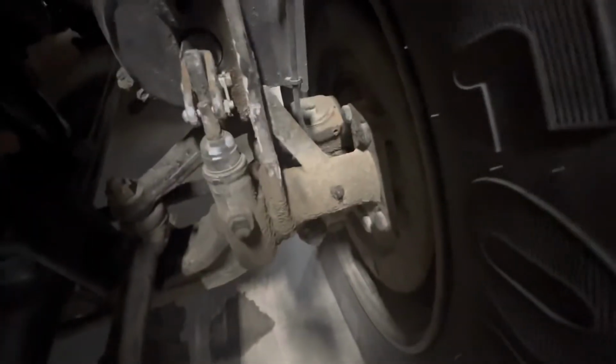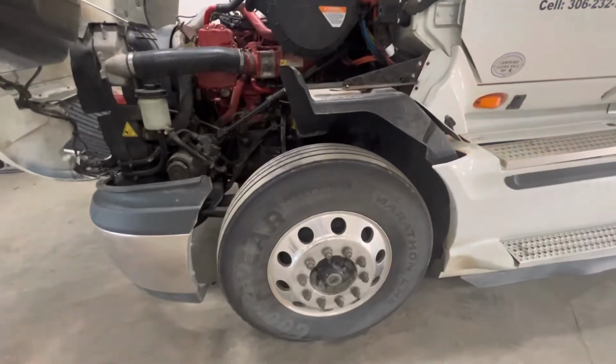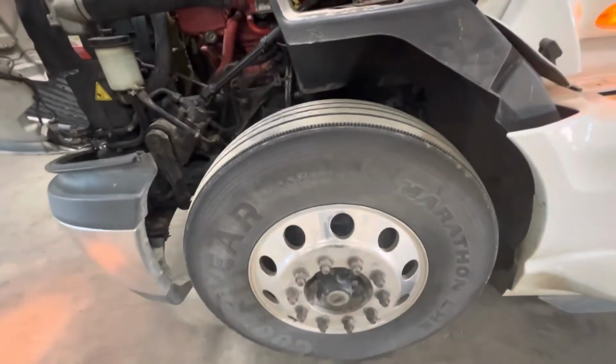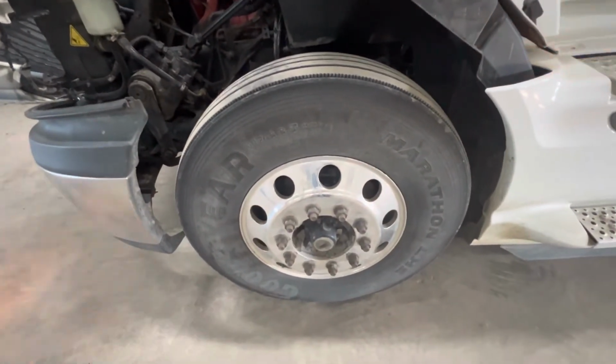Also coming back into the inside of the rim, where we're now going to be checking the tyre wall again, and also looking for any oil leaks on the inside of the rim, showing that there could be a potential oil seal gone. Coming back to the outside of the tyre, we're going to check our tread pattern again to make sure the tread pattern at the top of the tyre is adequate and fit for the journey. Looking down to the sidewall and the front, there is no visible damage, cords showing, or anything that's going to cause any potential hazards along the way.